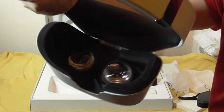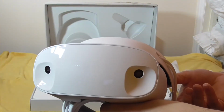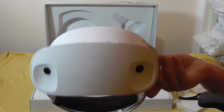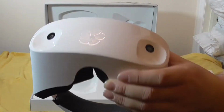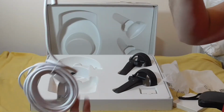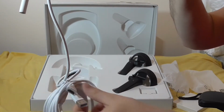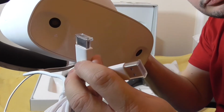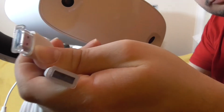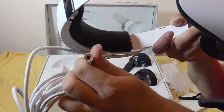The visor itself is a single unit with a cable trailing off it which carries the HDMI video source and the USB power and data between the computer and the lenses. It has a resolution per eye of 1440 by 1440 at 90Hz with a 110 degree field of view, which delivers a pleasing and immersive experience, but still pixelated enough for you to know that it's not real. The two cameras on the front are depth sensors and help you set the play area and warn you before you walk into a physical wall in the real world that isn't there in the virtual one. It is worth noting that your PC or laptop needs to have a built-in or a USB Bluetooth LE antenna for the controllers to connect to. This is not provided in the box, but you can get one for about a tenner on Amazon.